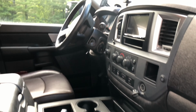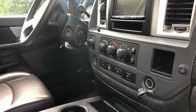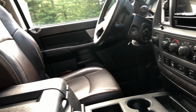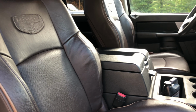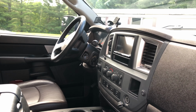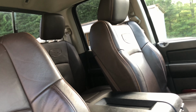The thing that's becoming an issue with the heated seats is something related to the way it is throwing error codes, or designed to produce error codes, most likely something with CAN bus. I deleted the CAN bus for these seats, but there's some issue with the CAN bus that's used with the 2008 truck that's a problem. But the other earlier models, it wouldn't be an issue.